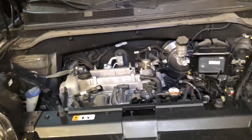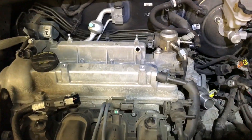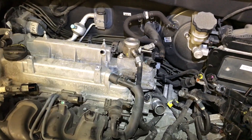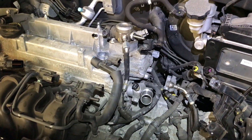I need to raise the car, remove the engine under cover, and start working on the alternator and the front timing cover. I also have to remove the back cover. All the wiring is straightforward — just follow each connector and be careful with the clips. On a 2014 the clips are fairly soft and not yet brittle from temperature, so it's easier to work with than on an older car.